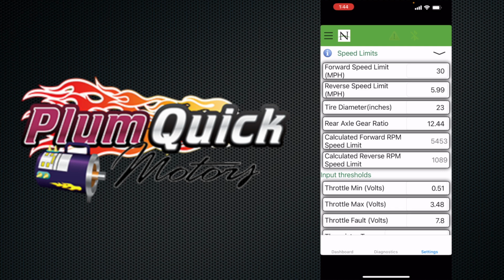Now just because you can change the speed limit there does not mean that you can put 100 in your golf cart to go 100. It's still limited to the performance of the motor controller and the batteries that's in the golf cart. I like to keep my reverse speed limit about the same here. 6 miles per hour is more than enough to go in reverse.